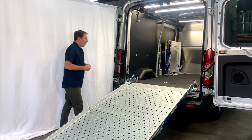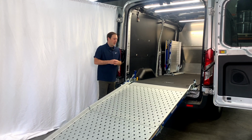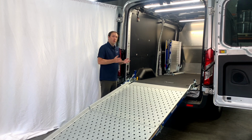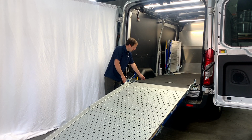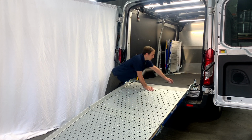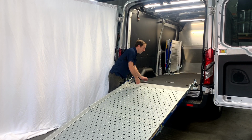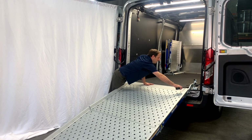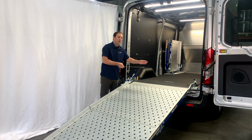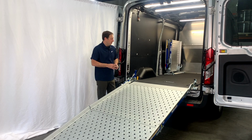But going back to one of the first adjustments we made where we positioned that passenger side lock, I mentioned the ramp deploying maybe a little crooked out of the vehicle, and it's really easy to check that now. What we can do is measure from the lip of our mounting plate to the lip of our ramp and make sure it's even across. In this case, we're at about 4 1/4 here and nearly 4 1/2 there. So I will bump that shoe a little further into the vehicle to make sure this is deploying evenly, but again, that's a cosmetic thing. This is pretty much nearly there.